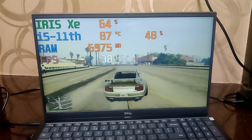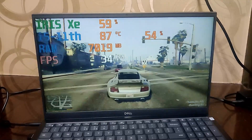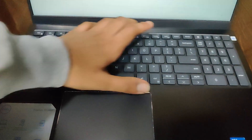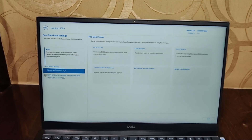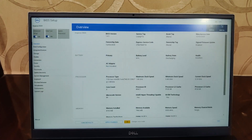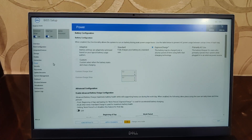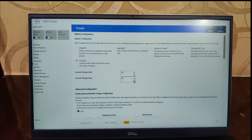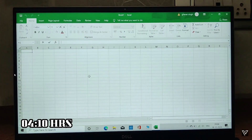If you use your laptop while charging, it will heat up more. To manage this, you can set the charge start and stop values by going into your BIOS setup — press F12 when the laptop is starting. Go to BIOS Setup, then Power Management, and you'll see options: Adaptive, Express Charge, and Custom. Set your custom start charge and stop charge percentages. This will protect your battery and help keep temperatures a little more under control.